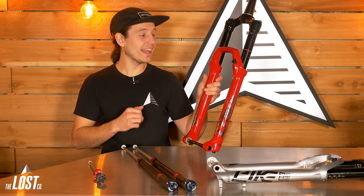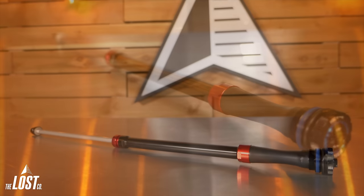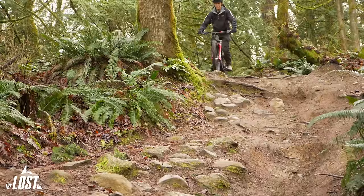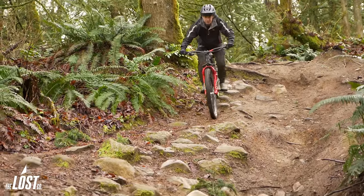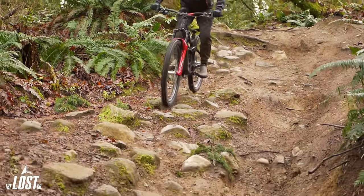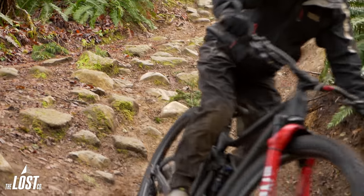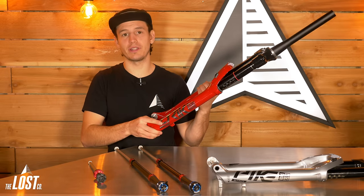The Lyric is the high-end fork and came with the RockShox charger damper. This uses an expanding bladder, and combined with it being totally sealed with no air within the oil, the damper results in better sensitivity and consistency. Charger damper forks just feel like they're glued to the ground with tons of traction and predictability — every tiny little bump is being absorbed and it doesn't feel like you're skipping around like with that motion control damper.